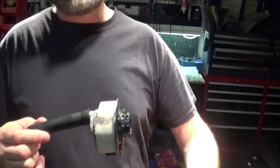So I guess the point is, when you look for a leak using a smoke machine and you cannot find it, put it in a tank, pressurize your tank. If you cannot find it, go under the hood, disconnect your purge valve, and smoke from that end. If you cannot find it there, go from the vent side, unhook the vent hose, and apply the smoke from that side. Otherwise I would never find this ever. It was impossible to see it.